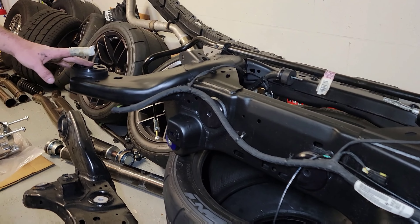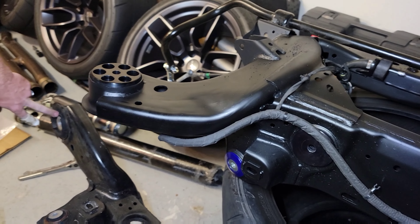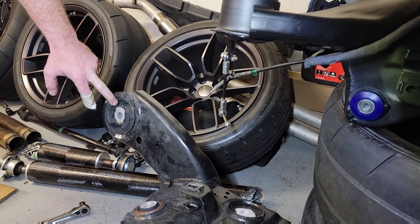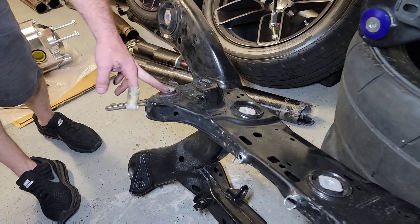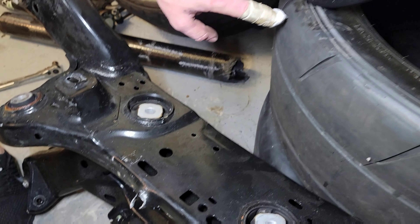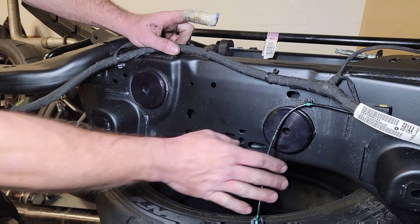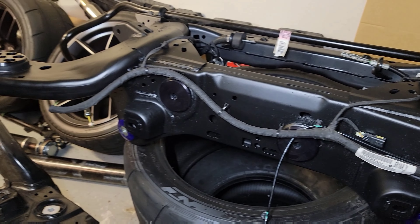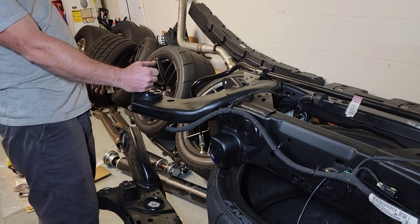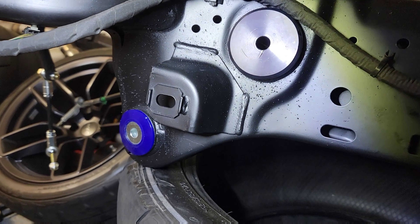It's been a long journey and I would say we're almost there. With the solid aluminum cradle lockouts — the solid aluminum cradle lockouts — you can see we got rid of all of the rubber. We put them side by side so we have the factory cradle here for you. All of the rubber mounts including the lower control arm and diff have been changed. We did the lower control arm to Super Pro poly bushing, and the diff lockout — solid aluminum — also from BMR. So we did the BMR diff lockout, BMR solid cradle lockout, and the Super Pro lower control arm. On the factory cradle, everything's rubber.